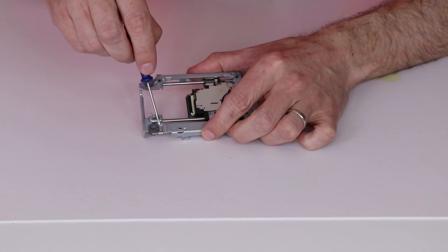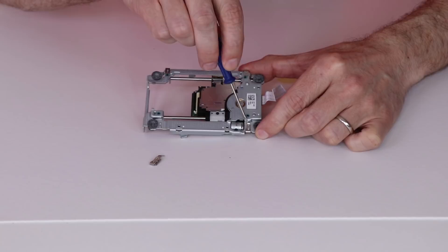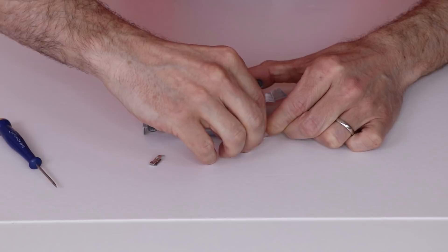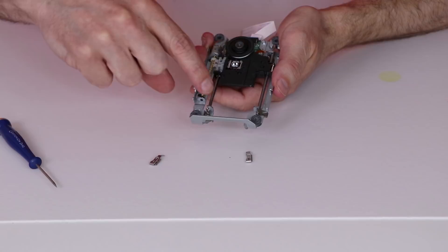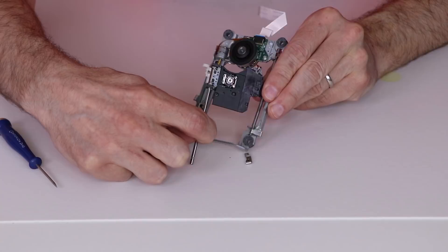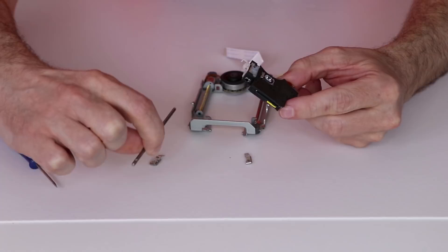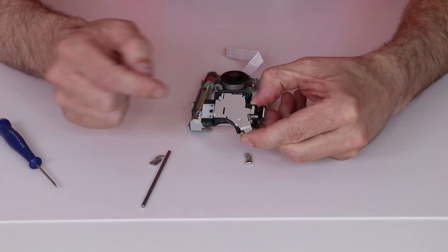To remove the laser, we use our small flathead screwdriver to get under this tab and pry up and push out at the same time until it loosens the clip, then do the same on the other side. With those two clips removed, we flip it over. The bar is now loose — we move it out and flip it up, then pull the bar all the way out. That loosens the entire laser. Pull the bar out and you have the laser removed. If the white piece is on the old laser, remove it and put it onto the new laser as new ones usually don't come with it.